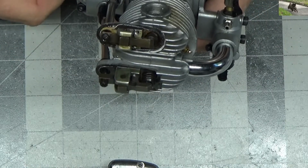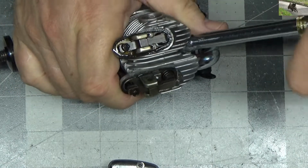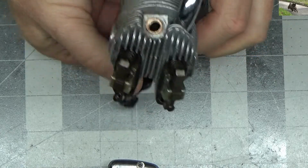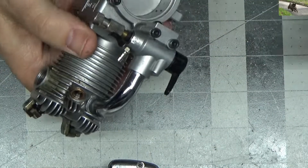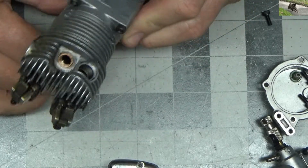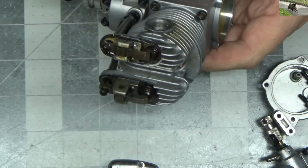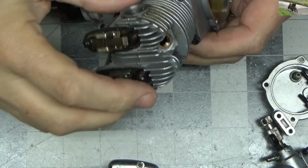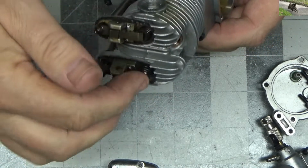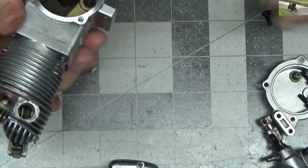So if I go to my intake, now we're going to the compression stroke here. Pull this out. Eyeball where top dead center is. And yeah, let's just do it with the rear cover off. It'll make it a lot easier. Okay, so let's see here. On the compression stroke, top dead center. Yeah, this intake valve is set too tight, so that's why we have no compression there. Because that's set too tight, so that valve's not closing, while this one is way far open. So that one's starting to open already before this one. No, it's just that intake rocker arm is just set incorrectly.